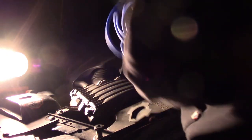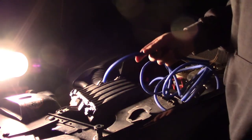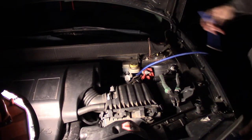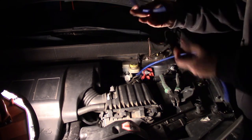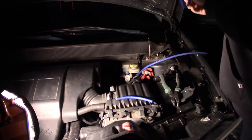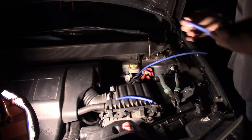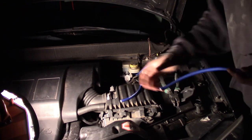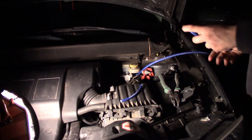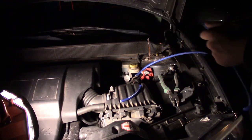The next part is cutting off a small piece of wire for our fuse. I always cut off more than I need — this piece is about a foot of wire. That short piece will go from the battery to the fuse, and the rest will go from the fuse to the amp. The first thing we're going to do is solder our connections.